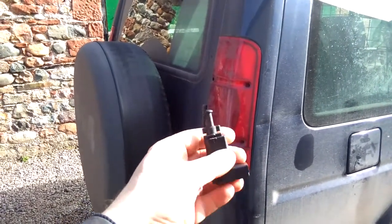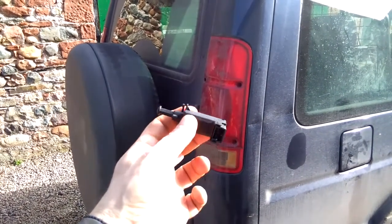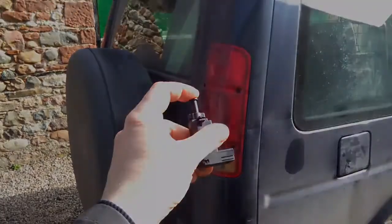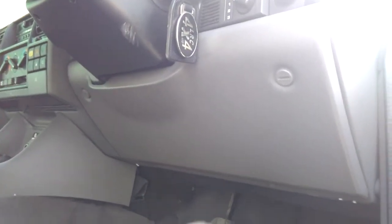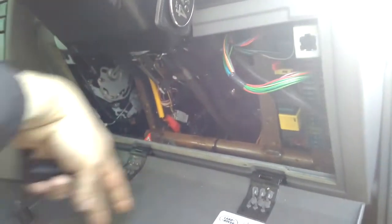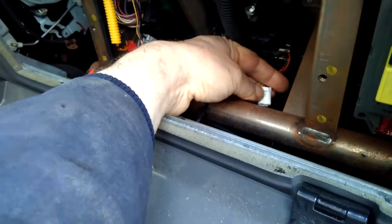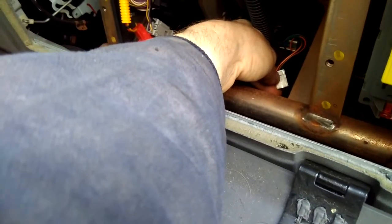This is your brake light switch, and today I'll quickly be replacing this. You'll find your brake light switch in here — it sits on a bracket at the top of the brake pedal, and this normally fits in there. It's connected to this plug right here, which if you look in you'll be able to see it's sitting about like that there.